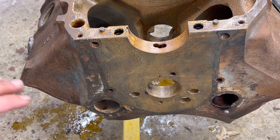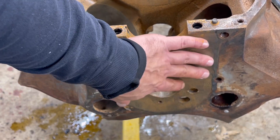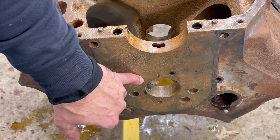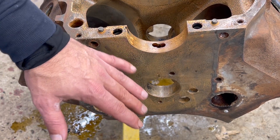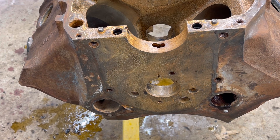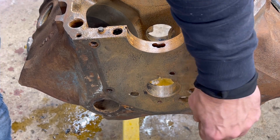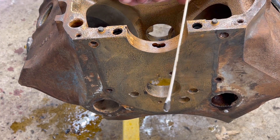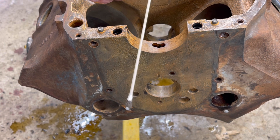One thing I haven't done 100% yet — this is a representation engine of what I'm going to be doing. You really do need to make sure all the gasket material is off of here. I've got a whole bunch of it on there still. The other thing is, when you go through this, you can still see some water weeping out. I did go through here with compressed air and blew out all the holes. I'm going to explain that in another video, because there is actually another step that I do before I go to a machine shop. These are your main two oil galley holes, and I really rammed a bunch of rods through that — and guys, look at that. That's disgusting.